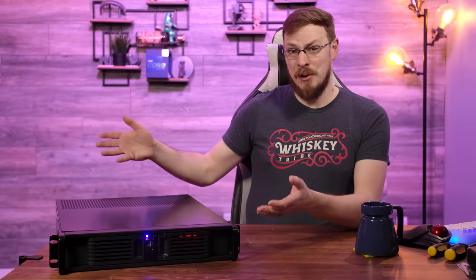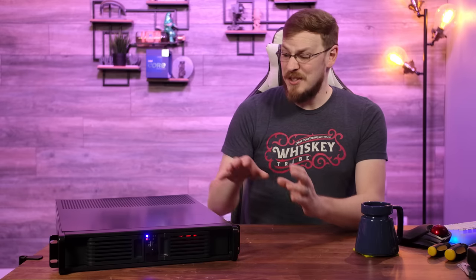And check it out — you are looking at what could be your first home server. Aside from taking twice as long as a typical PC build, this system came together with minimal trouble. The hardest part was routing cables around the chassis, as 2U cases have surprisingly little room inside them. The motherboard had to go in and out multiple times to lay cables underneath it, like the EPS connector that stretches from one corner of the case to the other.